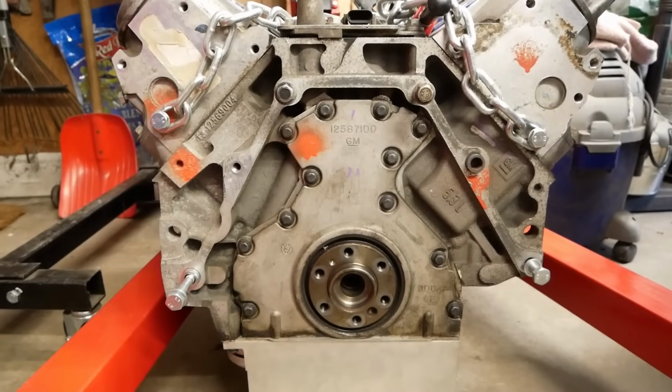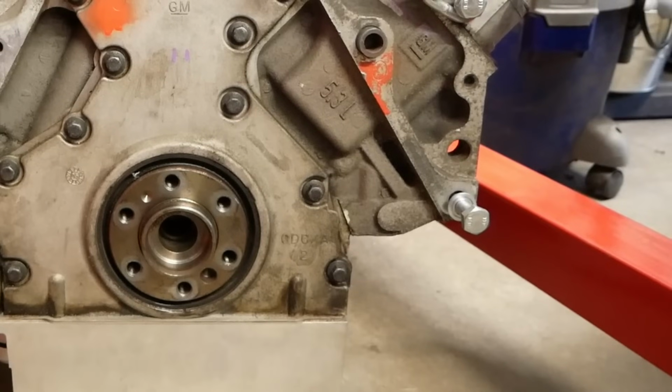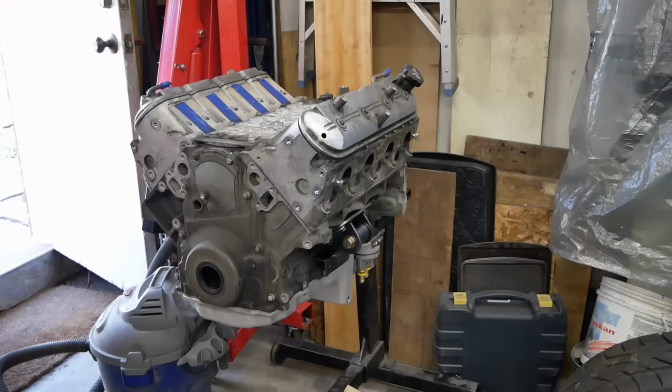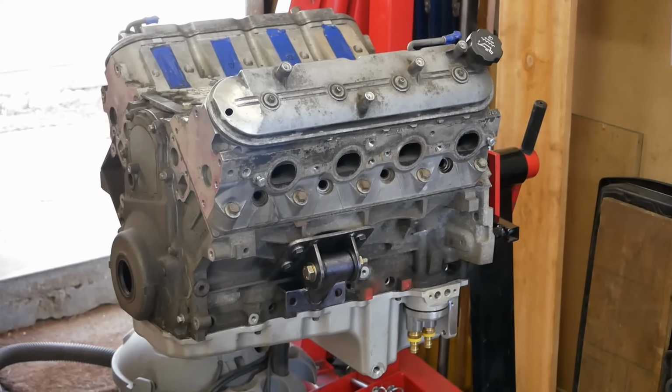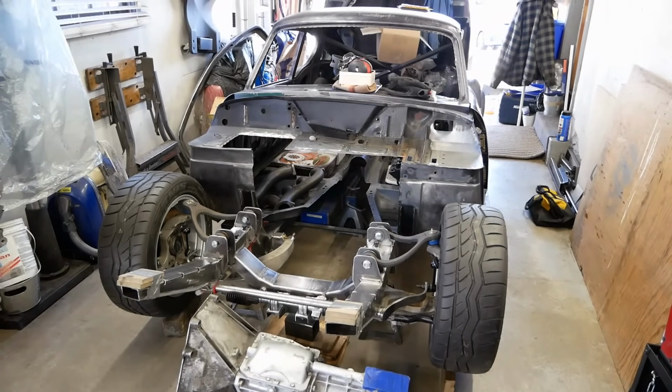Mounting a starter will be difficult, as there is no mount. To make matters worse, the LS4 only ever came paired to an automatic gearbox, meaning there are no off-the-shelf flywheels available, and thus, nothing to even aim a starter at. Put simply, this is a quandary, and it's why the LS4 is, at least hardly, ever used in a rear-wheel drive setup. So, why on earth are we messing around with this?